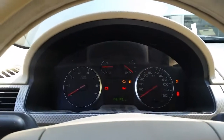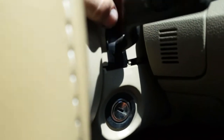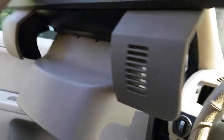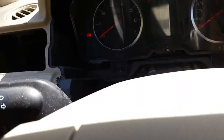We have to snap off the top cover of the steering column by putting a screwdriver into the gap and pulling upward, or by grabbing it and pulling up really hard on both sides. This trim cover is actually attached to the bottom plate of the trim panel, so it'll be a little tricky — you'll have to flex it and fight it to work it out. If you have the climate control system with digital temperature control, on the backside of this little vent grate there'll be a wire connector for your temperature sensor that you'll have to disconnect as well.